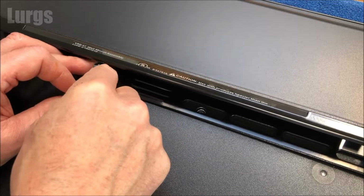So as with all my videos, just do these hand tight to start with. You do not want to go straight in with a powerful electric screwdriver or something because you do not want to damage those threads. So always hand tighten first. That way there's no damage to the threads. Now the reason we're not tightening this fully down is to make sure that we've got enough space at the back of the TV for any cables. Make sure it's in the middle of the TV.